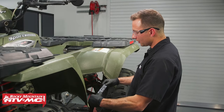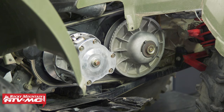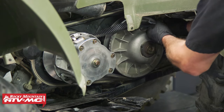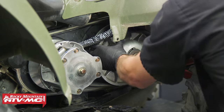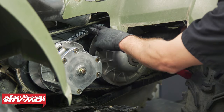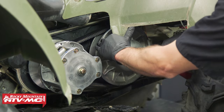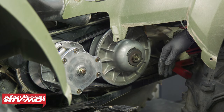To install the belt, make sure the markings are easily read from this side of the machine. Install the belt onto the drive clutch first, then work it onto the driven clutch. On the driven clutch, start at the bottom and work the belt in between the sheaves — rotate the movable sheave on the back side clockwise as you push up on the belt, and that'll help separate the sheaves to install the belt all the way on. Once the belt has popped into place, spin the driven clutch several times until the belt rides all the way up in the sheaves. If you don't do this, it's kind of like starting in high gear, and you risk burning the belt.